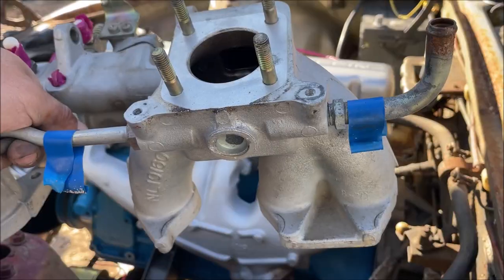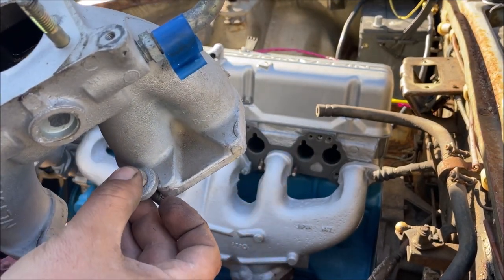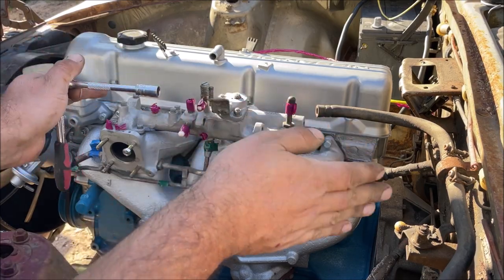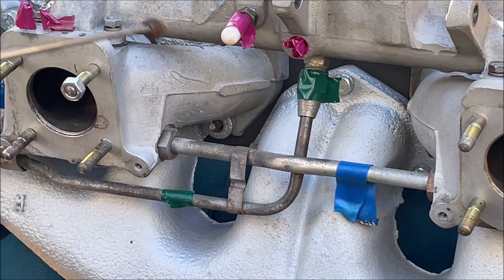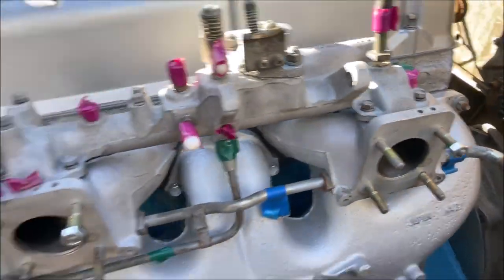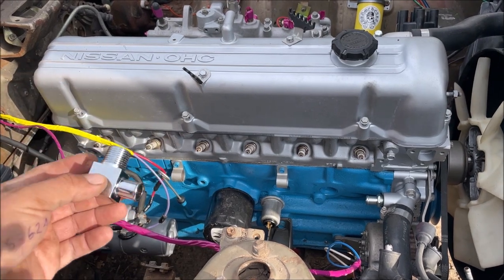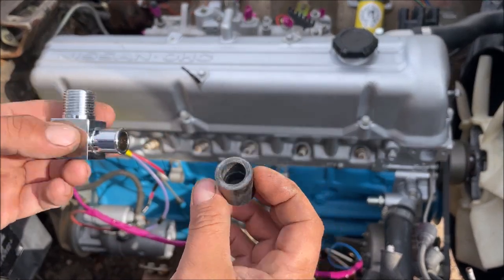Now that we understand this, we're going to put the intake back on the car. On the lower intake bolt — see how there's no hole — these big washers are going to hold it on and they're dual with the exhaust manifold, so you need these big fat washers for a swap. Loosen the 10mm bolts to free up the two sections. This is actually going to be a pain to get bolted up. When I get something ready to start I go through everything so I don't have problems. Found this piece for $15; we're going to run a 5/8 tube there to there — take a sample piece because it's very easy to get the wrong size.